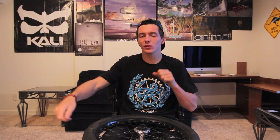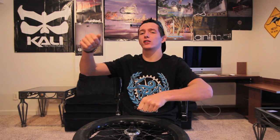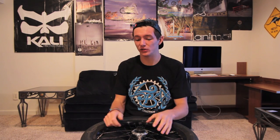Basically, it's like a cassette when you're pedaling, so you have engagement. But when you're rolling backwards, if you go a little bit faster, then the hub will coast itself going backwards. This is if you're in cassette mode. Mind you, this is very confusing, so I'm gonna try to explain this throughout the video. But naturally, when you fakie, you go a little bit faster than the hub would itself. So what that does is engage it into free coaster mode. So you can't actually ride it like a cassette doing backwards manuals and stuff, unless you go the exact same pace as the hub, which is very, very difficult.